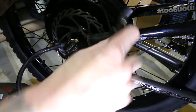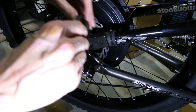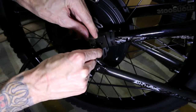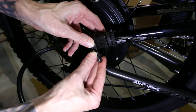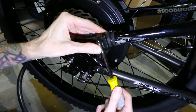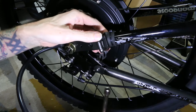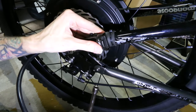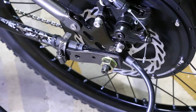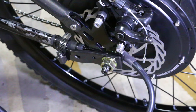It's easy to do and it doesn't take much, so might as well do it. I'm attaching the rubber with some zip ties — super easy — and that's why I left a gap, because the rubber has a little thickness. If you made it laying straight on the frame it's not going to sit as well when you tighten it with the hose clamp. Once you've done that, throw the hose clamp over the whole thing and start tightening — you want it pretty tight but without going too far, because hose clamps are pretty easy to strip. Hose clamps are very strong and have the mechanical advantage of being further from the pivot point, so they don't need to be insanely tight.